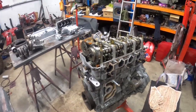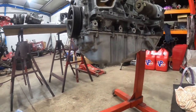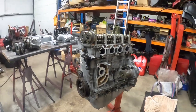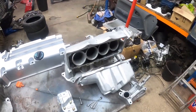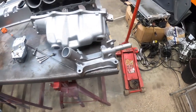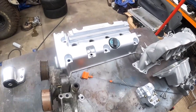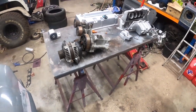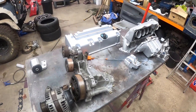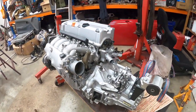Me and Josh have completed putting the engine back together. We've now got a baffled sump with a clockwise motion baffle in there. All the timing chain and everything's been renewed. I've also been doing some show prep — I've sent a couple of bits off for vapor blasting and they've come back looking ace, like brand new. We've got the water neck, the RSP intake manifold. I've painted the rocker cover back to silver and spruced up a couple of other bits. We're only about four weeks away from going racing, so we've now got this engine completely complete, all the new bits bolted on, and it's pretty much buttoned up and ready to go back in the car.